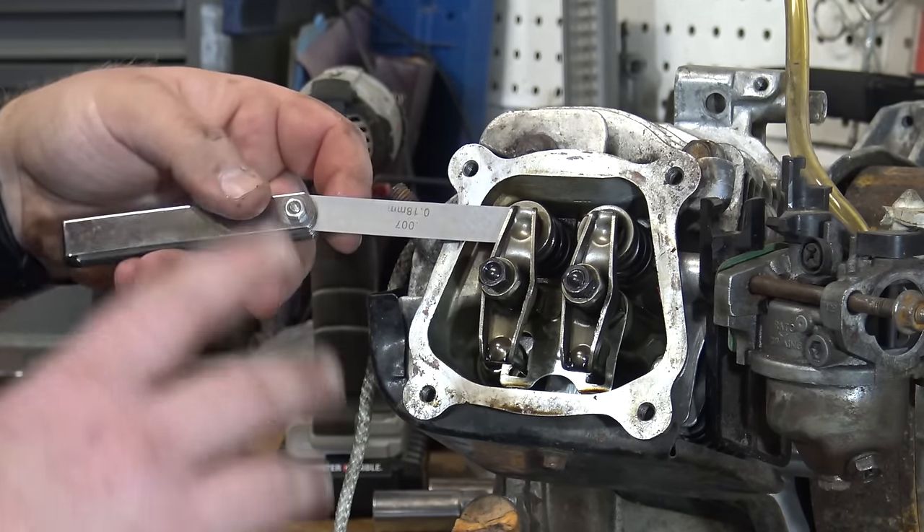Make sure to go check out Go Power Sports for all your go-kart and mini bike needs — they have these 18-pound valve springs, so pick up a set if you're removing the governor because you will need them. The non-Hemi Predator will float the valves around 5,500 RPMs — it's definitely a must-have if you're taking out the governor. Make sure to check us out on Facebook and Instagram, give us a like and a follow. We put pictures out before the videos come out so you'll know what to look forward to. Always check out the links in the description below and always come back to Redbeard's Garage. I'm out.